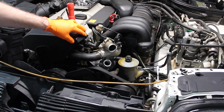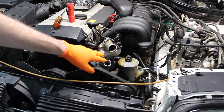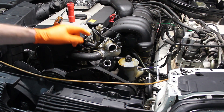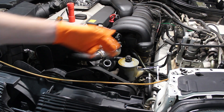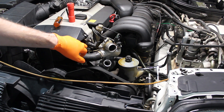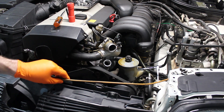What I'm going to do is start by loosening all four of the water pump mounting bolts after I've taken off the serpentine belt. I already cracked loose the hardest-to-reach bolt, which is accessed through behind the power steering pump, in between the water pump and the power steering pump mount point. I used a wobble extension with a 13mm socket, a long quarter-inch drive extension, and a quarter-inch drive ratchet to break that loose. All the other bolts should be easy to get to — three of them are 13mm and one on this particular car is an allen head. I'll go ahead and pop the serpentine belt off and then start removing the water pump.